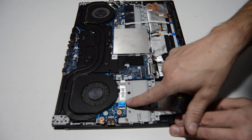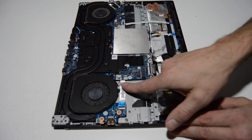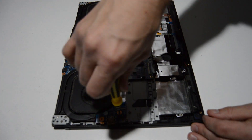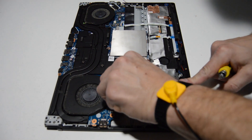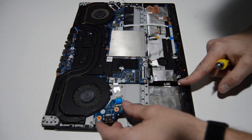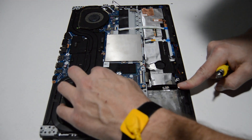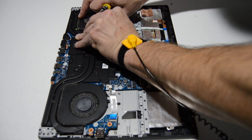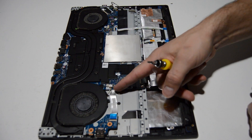The I/O board or USB board is connected to the bottom of the motherboard, so we're going to go ahead and remove the screws and untape that ribbon so it pops up. Since we'll be removing the fan assembly next, we'll push those fan connectors out of the slot — each connector has a little tab on either side so you can get a grip on it to pull it straight out.